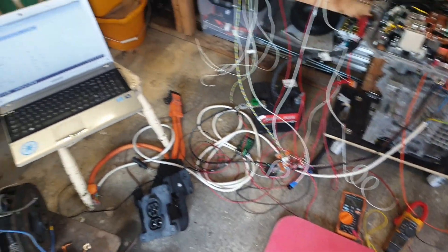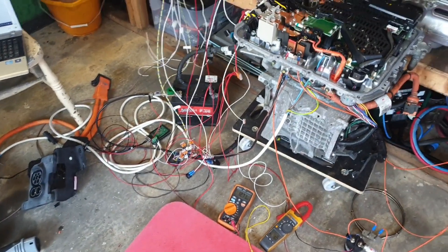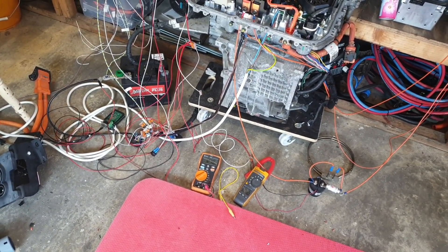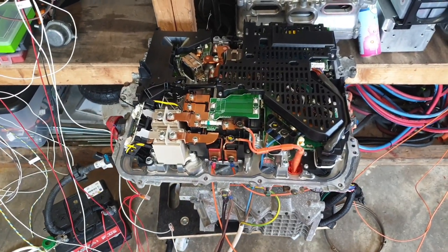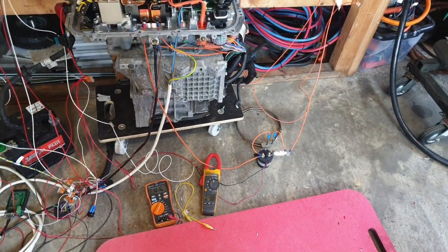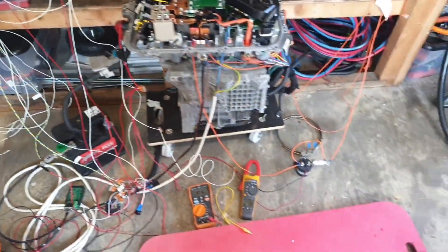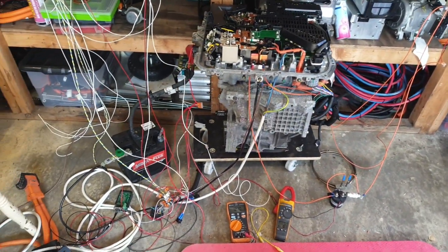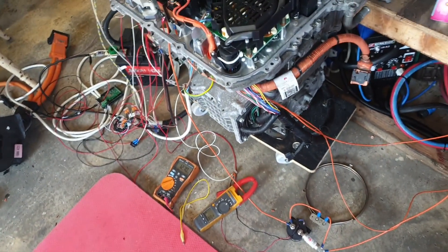Hello folks, we're back with the Leaf PDM hacking saga. I want to demonstrate that we've worked out how to power-control the charger function of the PDM. At the minute everything is turned off — the VCU is powered on, but all power to the PDM, inverter, and everything else is now controlled by the VCU. We've got our 12V battery on, and I'm going to put the power supply on to get power from the land yacht demo port through to our pre-charge and into our Leaf stack.